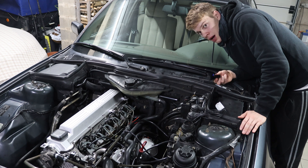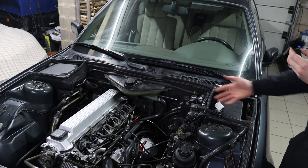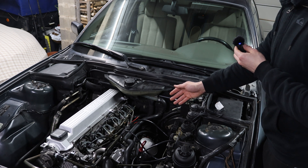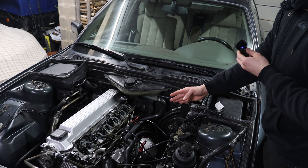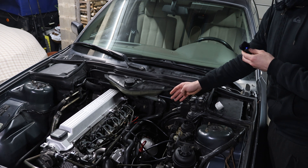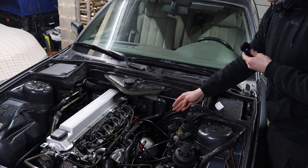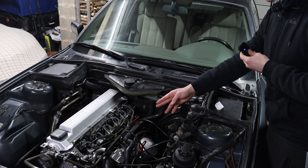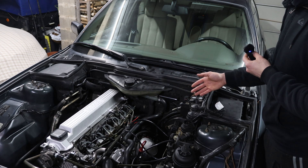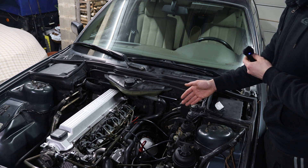I know why and now I need to pull the engine harness. This is part of the old connector — as you can see the blue stuff is old coolant. Since in episode 2 we found the temp sensor was literally leaking coolant, we replaced it and discovered coolant left in the sensor clip. I cleaned the clip with no difference, then cut off the clip and put on two wires directly to the sensor, but still got the same error codes. So I'm going to pull this part of the engine harness and redo it where I have more space. I hope I don't have to remove the whole engine harness because that would be a bad day. This project just keeps getting worse — after the pump rebuild it just won't start either.